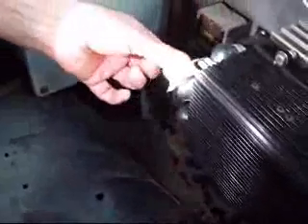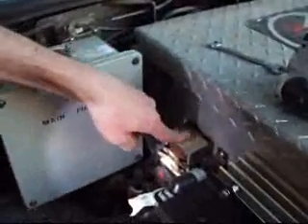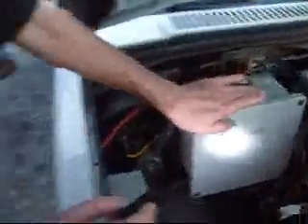It's an extra safety. So basically you've got this wire and this contactor producing a safety situation where if you turn off your key and lift your throttle, the controller shuts off. You turn off your key, this contactor shuts off — and that's it. There's a safety here, and that's basically it.